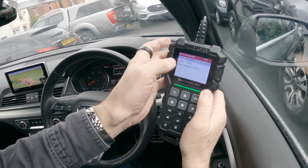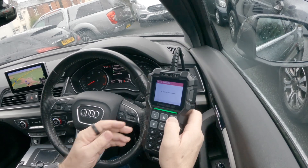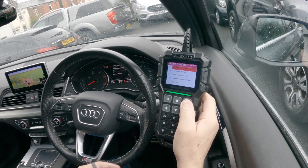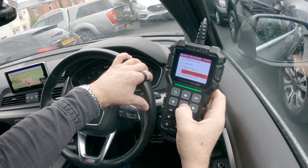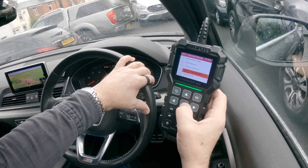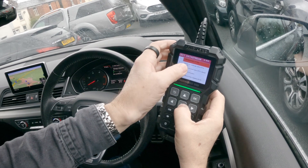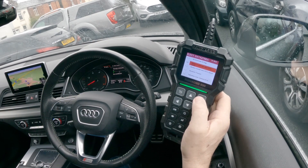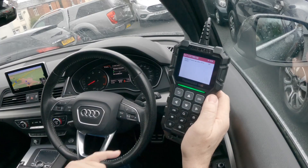You can also select individual items rather than viewing all. Go to Select Individual Items, click OK — it loads the list and you can pick specific ones, for example: vehicle speed, absolute throttle position, time since engine start, distance traveled whilst MIL is activated, number of warm-ups since DTCs cleared. I make sure that warm-ups figure is over seven to start with. Here it's 129 — that's a pretty accurate picture, and it's brilliant.